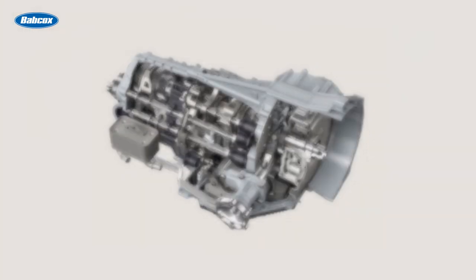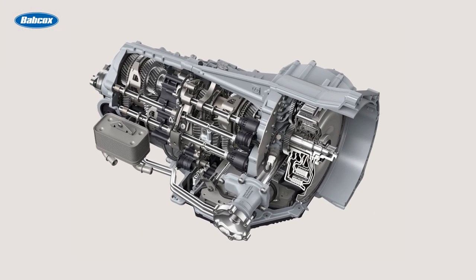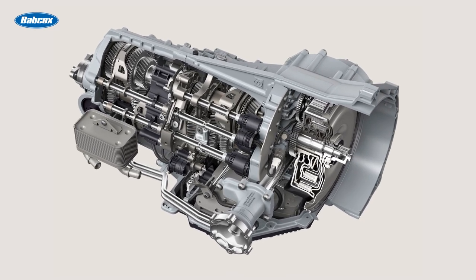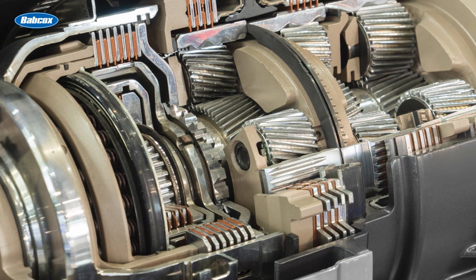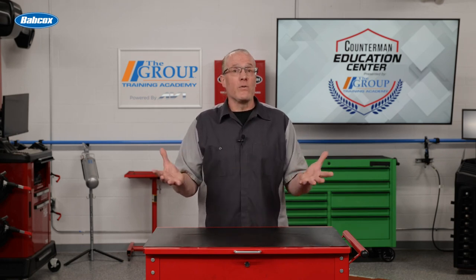The latest technology in clutch systems is the dual clutch transmission, or DCT. A DCT is basically an automated manual transmission — there are two clutches and two input shafts: one clutch for odd-numbered gears and one for even-numbered gears. It's all computer controlled and shifts very quickly. When in one gear, the next is already selected, so when it's time to shift, one clutch is disengaged as the other is engaged. These are manual transmissions you can drive like an automatic. Thanks for watching.